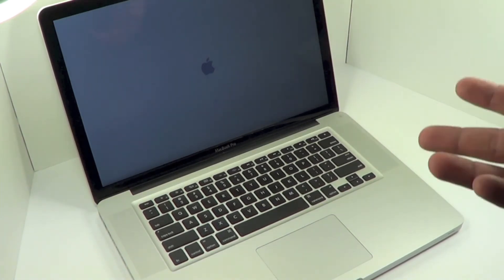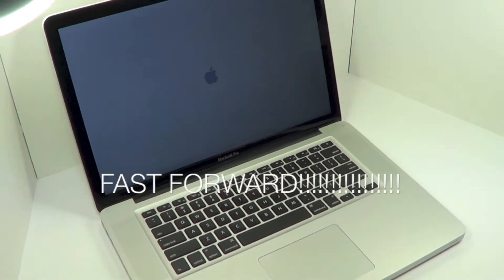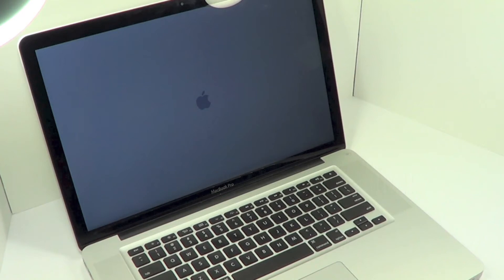I just started rebooting it. One thing to keep in mind: if you hear any clicking or unusual sounds right before it turns on or as it's rebooting, that means you've done something wrong or there's something wrong with the RAM you purchased. Also keep in mind that after installing new RAM, it'll take a little bit longer than a normal boot — that's normal, don't get frightened.